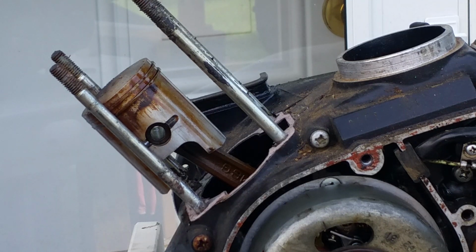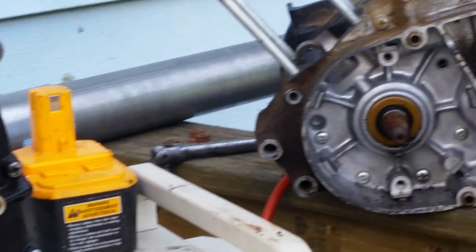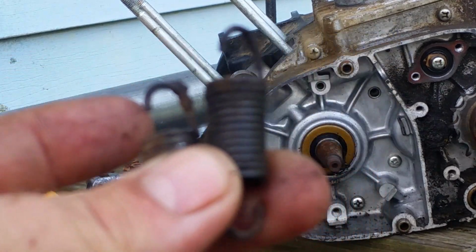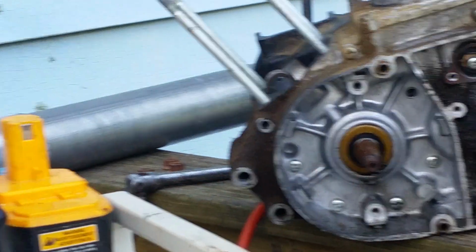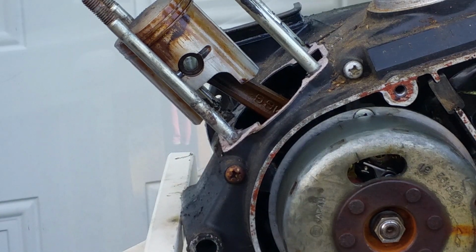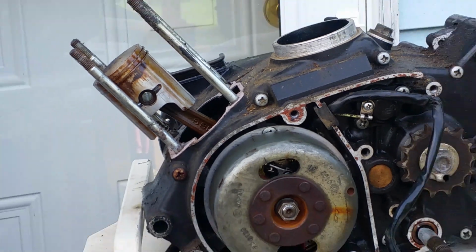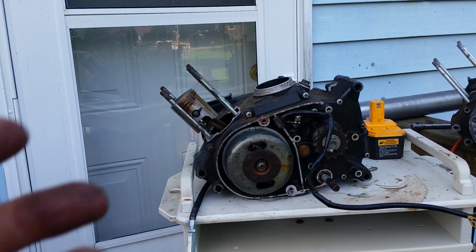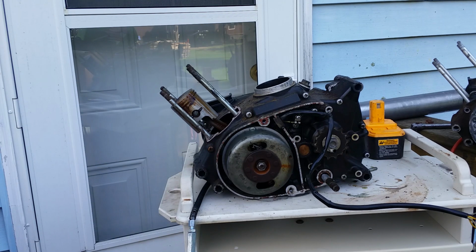And then of course the G4 motor, the one I told you you have to modify the exhaust, is held on with exhaust springs, whereas the G5 motor is bolted on. So these are a couple of different variables that you'd have to consider when doing this changeover. But I'm going to tell you right now, by changing them over, you just took an old bike, and not only did you update it, you made it so you can readily get available parts for it.